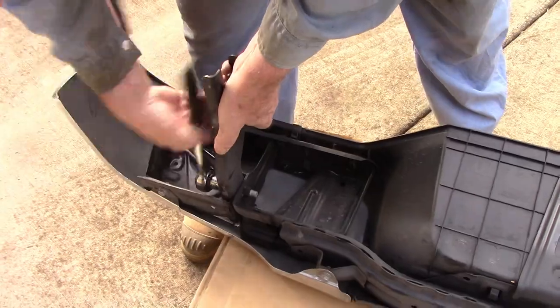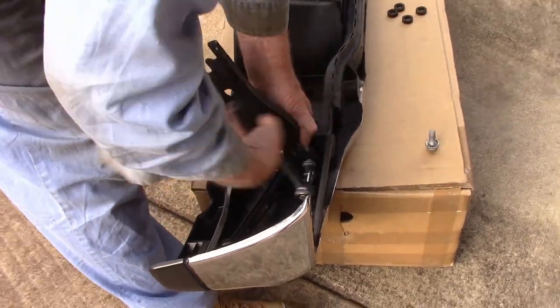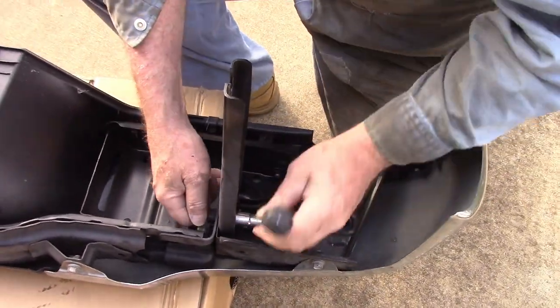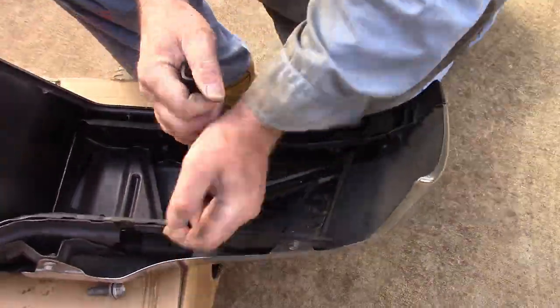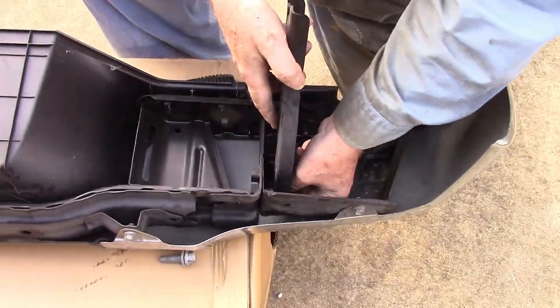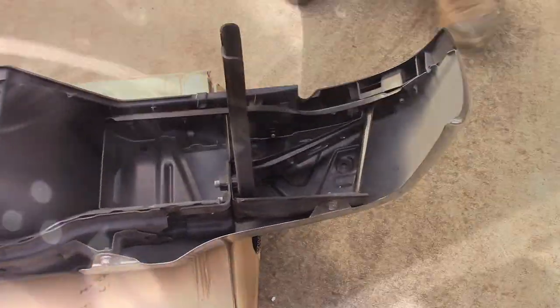The next job is to take the existing brackets off the bumper bar. We need to put some spacers in against them to move them out a little bit wider so they can bolt back onto the new brackets holding the towbar. Hopefully you can see the little black spacers I'm putting in here — they come with the towbar kit and are obviously the right size for the job. Next I get under the car and do up all the bolts that hold the towbar on, but only loosely, because the towbar still needs a little bit of movement as we've still got to fit some things onto it.